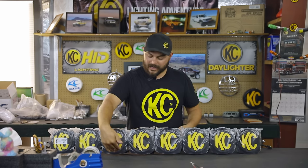Drawback number two is hood glare. We've done the best we absolutely can to minimize hood glare and glare off your dash back into your eyes, and that's why it's so important to have an overhead light bar that is distance oriented. If you turn this on and some of the cheaper light bars just light up everything, you get even more glare off the hood. It's the same problem as the reflection of dust back in your eyes — you can't see, and the whole point of having a light bar is so that you can see further. Back in the old days our catalogs featured shields that would mount underneath the lights, like the little bucket of a shovel, to help aim the light further. Today you don't really need those because of the design and geometry of the optics and reflectors inside these lights — it's much easier with today's technology to produce something without that amount of glare, but inherently it is still going to be there.